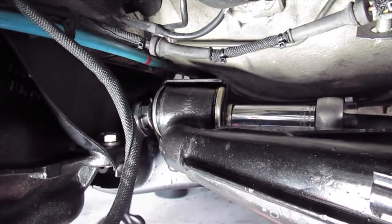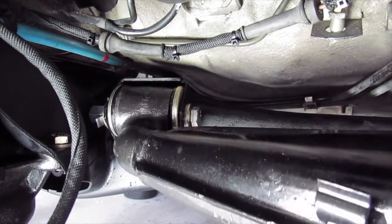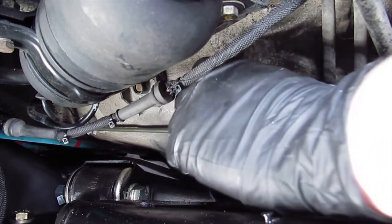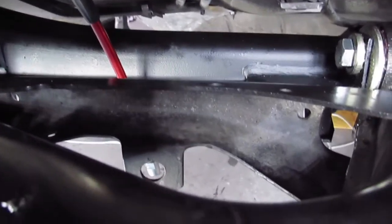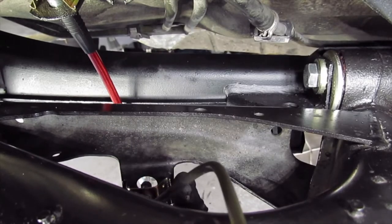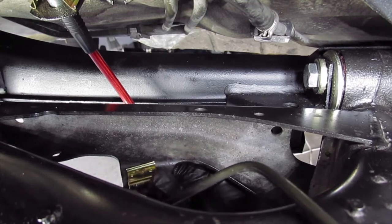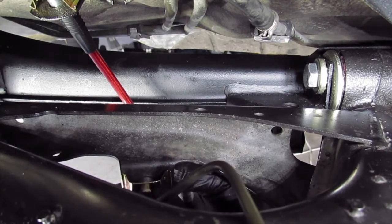The bolt doesn't move but the bushing does move inside those captive toothed rings. The next natural thing is to put in the flex lines that go into the trailing arm — the ones we absolutely destroyed to get out. These are Garagistic. It runs from the top and comes in — there's a circle that helps secure the other end. That is the original brake line, just re-electroplated. The little securing tab is in the back, and you want to seat the flex line from the back first. I've left the hard line unclipped so I can get the alignment on the threads right.